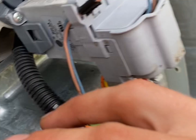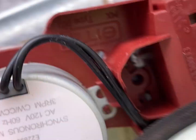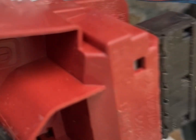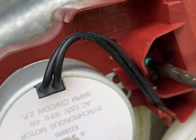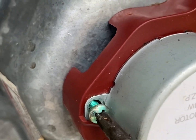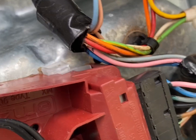I'm going to go ahead and grab the new one. As you can see, I've got the two sitting here — we're going to go ahead and put on our replacement. Pops in that groove, and you want to make sure that you connect it. Go ahead and pop that wiring harness in, make sure it's in there good. Grab your two Phillips head bolts. Go ahead and push that one in the hole, same with this one, and then go ahead and tighten them. Tighten both sides down at the same time so one side's not tighter than the other. Put those bolts in there snug, and that's good.